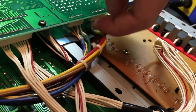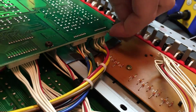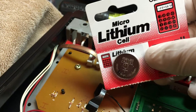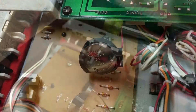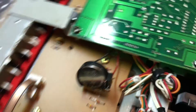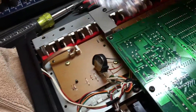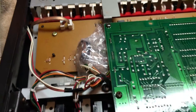You'll want to visually inspect that you've replaced the motherboard, the screws, and the wires back to where they're supposed to be — just give them a little push to make sure it's snug. Here's the battery I'm going to use. I'll use a rubber glove to put it in place. I've snapped it into the battery holder, and now I'll use some anti-static bubble wrap to make sure that it doesn't bounce around or touch anything.